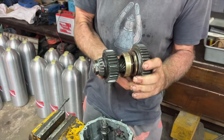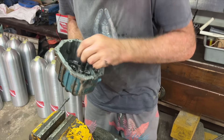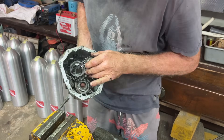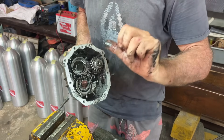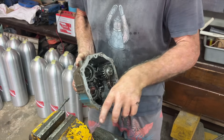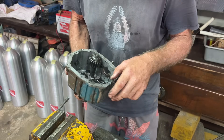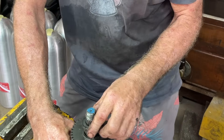This last one here - this is the thing I want - this is the clutch mechanism and the two drive cogs. The rest of it I can basically put aside. I'm having a quick look at the bearings - they got changed last time - I'll give it all a clean out, but if you're doing this for the first time I would clean everything perfectly with a toothbrush, check all the bearings, check all the seals, make sure there's no leaks. But I've already done this before - I just need to change the clutch.